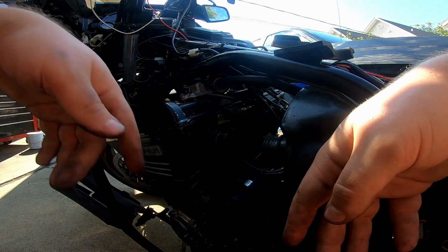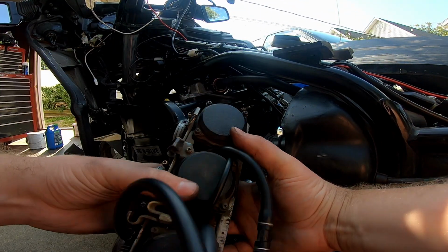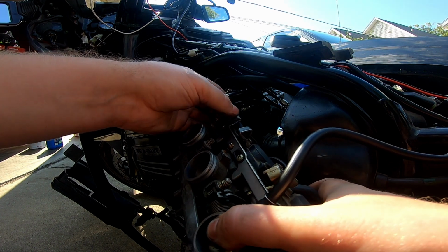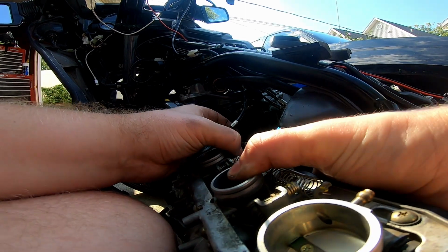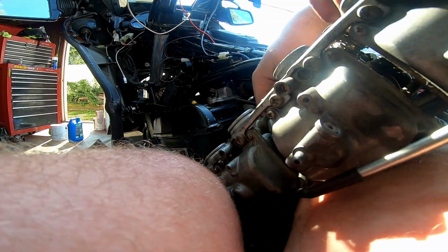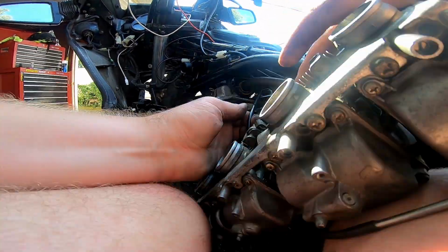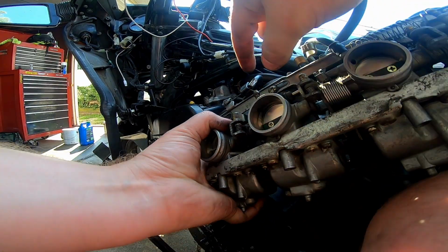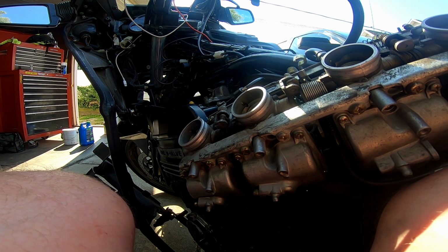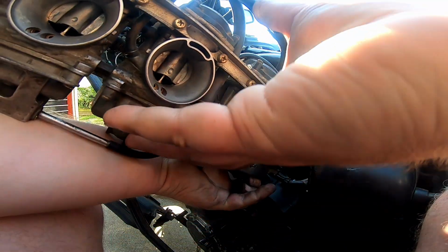I'm actually gonna recommend starting with the choke. And let's hope and pray to God that this thing doesn't snap off. Maybe, can I show you this while I'm doing it? Maybe. So we got this little guy here. She sits in there. Hopefully I'm going the right direction. And then, like I was saying, you kind of gotta finagle this son of a bitch. There we go. Okay. So you can see this thing is a keeper for that. It holds that. And when I move the choke lever, it smooths the slide. There's a spring, you know, it's pretty basic. Cool. Next.